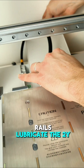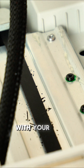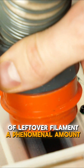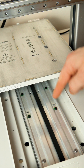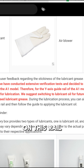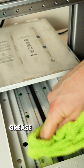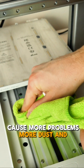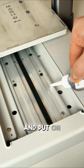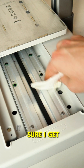Next, lubricate the two Y-rails, which involves removing this piece here. It's quite simple — you'll be able to feel where there's a seam with your nails and just pull it up. My printer had a phenomenal amount of leftover filament in the bottom, so vacuum that out. Most Bambu printers were shipped with grease on this rail, but Bambu now recommend removing that and putting oil in its place, because apparently grease can attract more dust and cause more problems. You know you have the grease because it looks like clear toothpaste. So wipe it down and put on some synthetic oil instead, giving it a final pat down with a paper towel to make sure you get it in everywhere.